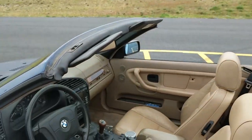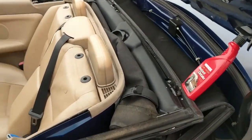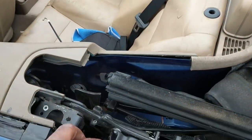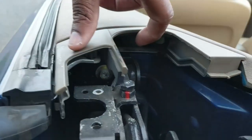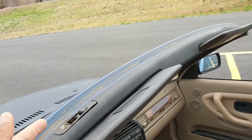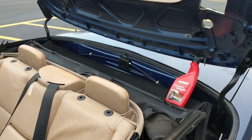But yeah, this is a rough explanation, but we'll do another really quick rundown. So it's three bolts to hold the actual top in. You've got two brackets on each side, three bolts: a bolt there, and a bolt right there. To release the front, again, I put the directions for that in the description, but you just have to unwind it. It releases the latches. Boom, the front's done. Do the front first, then do the brackets.